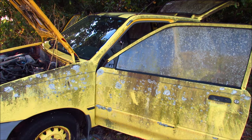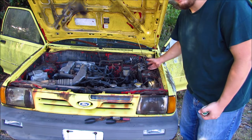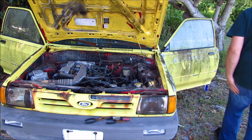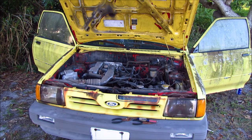She doesn't start just yet. Just in case people are curious, this fusible link right here — the EGI — that's what controls your fuel pump. I just took this off and cleaned it up a little bit; we'll see if that makes a change. I just wanted to have it on film just in case it did. It coughed there for a second. I'm going to get some starter fluid and spray it in the intake to see if we can kind of clean out the spark plugs — I think I just fouled them really bad. We're probably dealing with horrific gas. That's my guess.